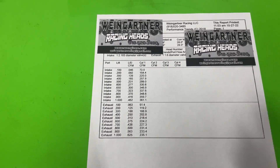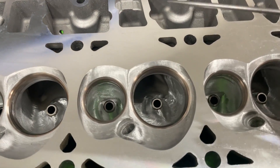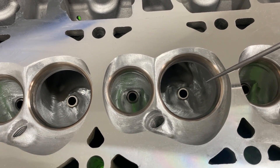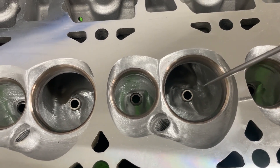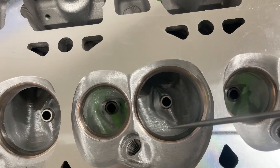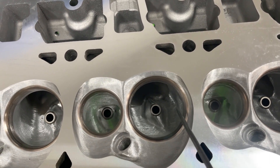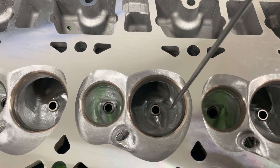Here's what's been done — I think you could do most of this yourself besides the valve job. I did my most aggressive 45-degree valve job because the seats looked worn more than normal, and port work gains flow with an aggressive cut — which it did. The other reason is the valve job looked pretty worn out, so the more aggressive angle went in easier. I opened the bowl up to 2.165, which is 100% of the valve. The throat — from here to here — is 91%. I will warn you: if you try that with a stock valve job you're probably going to lose flow, because with this more aggressive cut I can get the angles needed to make the turn.